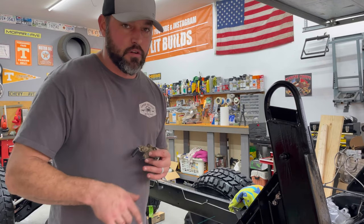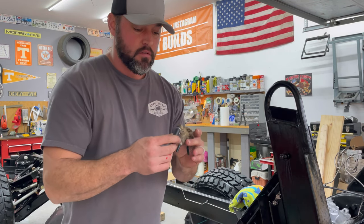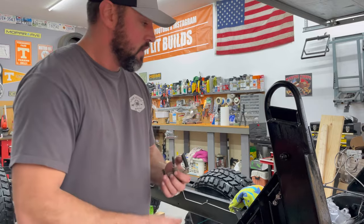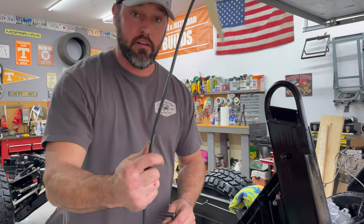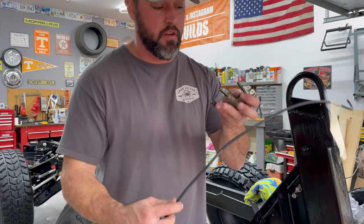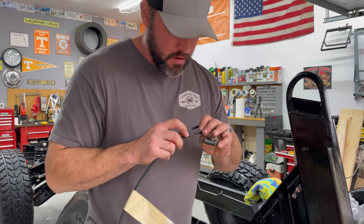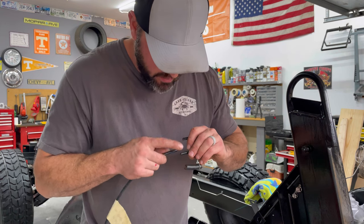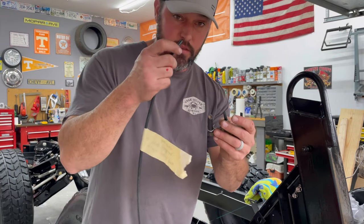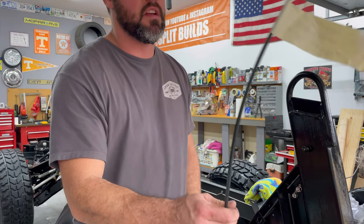So guys, I'm rummaging through this box of stuff that came off the Humvee, and I found the deep fording switch that they actually just cut, and it was still in the box. Can't believe it. Cleaned it up a little bit. So this is the vent hose, right? One of you guys reached out to me asking what this was, and yeah, it's just the cut piece. There's three lumens that are cut, and I was able to put this back where it was cut from. I'm grateful there were numbers sitting right here and the cut angle and everything. So this matched up beautifully. And I know now this went to the center of the deep fording switch. Hope it helps somebody out because they're cut on almost every Humvee. Let's go.